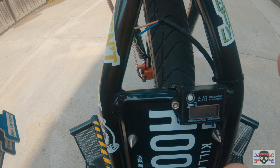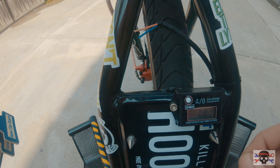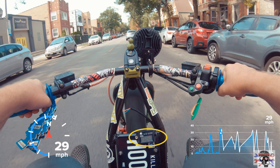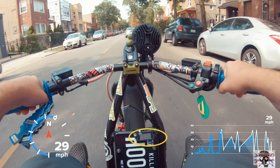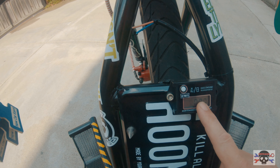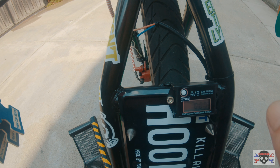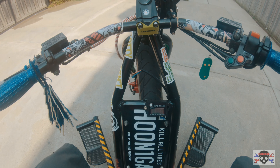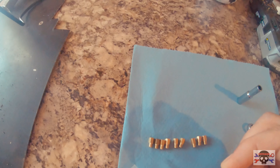We were only hitting around 36 miles an hour — you might have seen it in the previous video I did. We were only hitting 4800 RPM, and after changing that jet and revving it out, I just hit 5400 RPM. So I think we still have to go bigger.